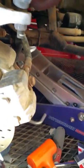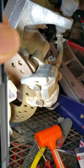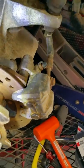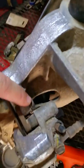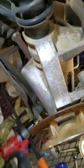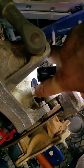Right here, these bolts — those are actually the brake pad pins. That's what holds both brake pads in. To take the caliper off, you have to remove this bolt back here, which is actually behind the brake caliper. They are 12 millimeter bolts. That is what actually holds the brake caliper on — this one and the one below it.